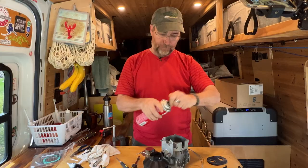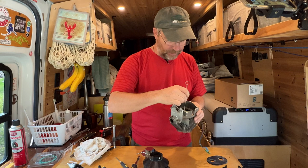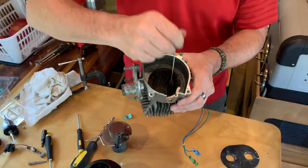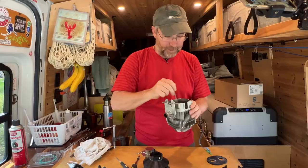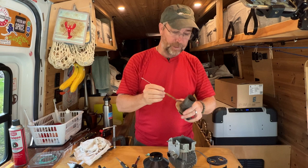Inside here, this is where you want to really start cleaning. In our research online, we found a guy who does a lot of heater maintenance and uses brake clean, so we thought we'd give it a try — and this stuff worked great for us. If you just spray it in there real good — you probably want to do this outdoors or in the garage — then using a brush, a toothbrush, and whatever wire brushes fit in here with brake clean all over it, you just clean as much as you can. Get this chamber as clean as you can, hit it with some brake clean again. Now that you've got it out of the heater where you can actually work with it, it's easier to do. Also try to get in here as well; hopefully this part won't be too carboned up for you.